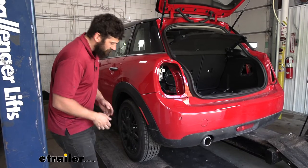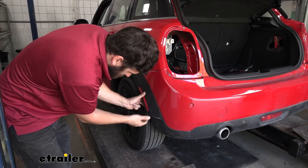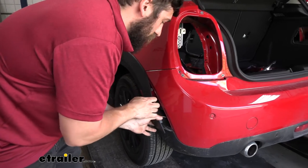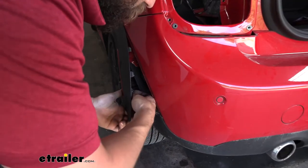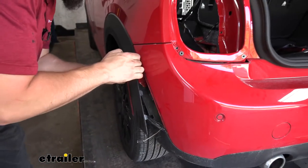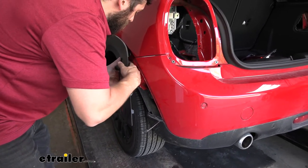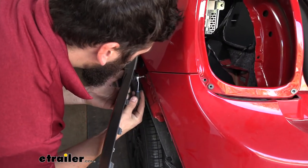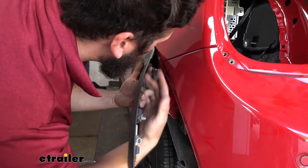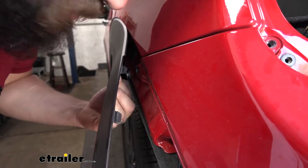Now we're going to come outside to either edge of our bumper and peel back the little fender liner. Once we get our hands under there we can release those clips. Once it's partially peeled back, you're going to see a connector — depress that tab and pull it straight out. We're going to continue peeling back the fender to the point where you can see a little Torx screw and remove that. Note: the taillight Torx fasteners were T20, but these last two are T25.